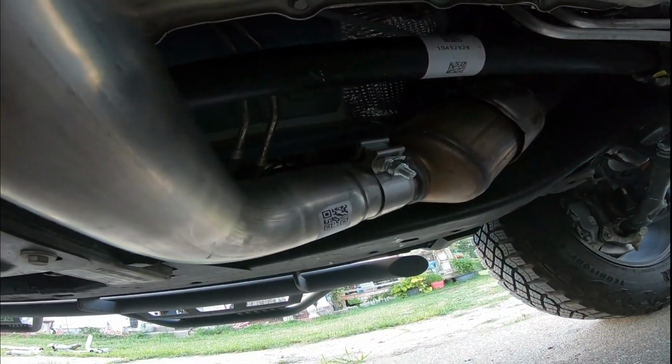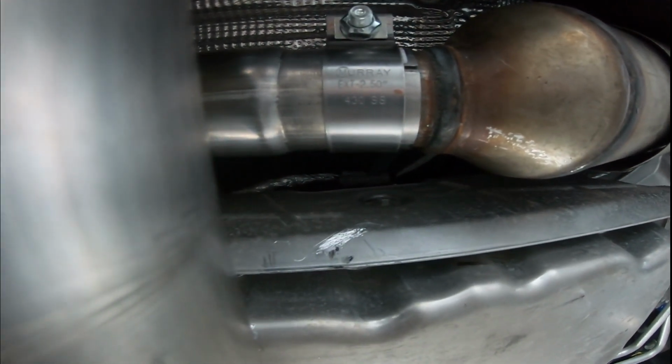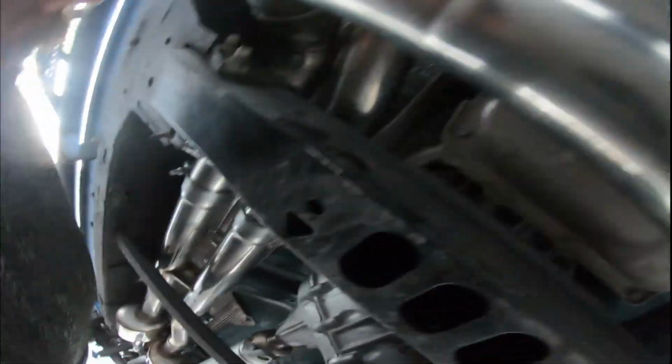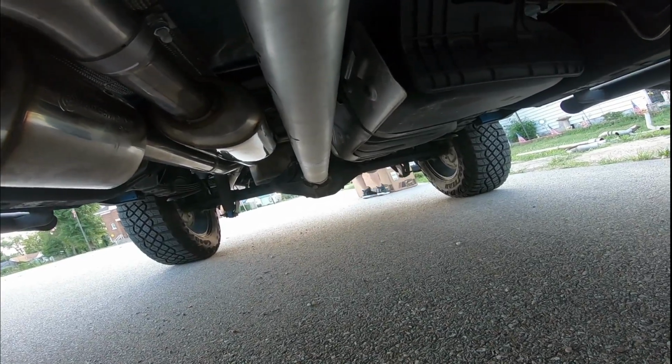All right, guys, we're back. I just want to run through real quick and let you know that these ones up here in the front are different sizes. So these are actually a 5/8, and they're actually smaller, I'm trying to show you here, hopefully 2½-inch clamps on the fronts. Every other one is a 3-inch clamp all the way back with a 15mm. I will say most definitely don't tighten anything down until you're all the way to the back. And then once I finish that out, I just tighten it all from the back to the front.